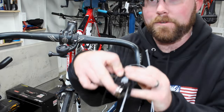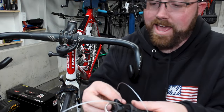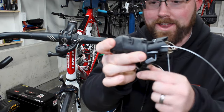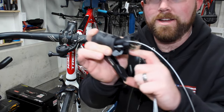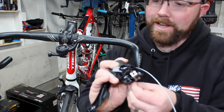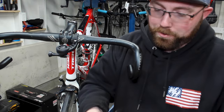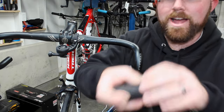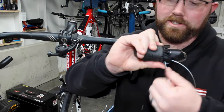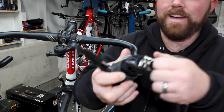On this side there's a gray cover that we can pop off just like that, and it just hangs off to the side. That lets us see in there to make sure the cable is going all the way through and gives a little bit of light on the other end. We're going to push our little lever all the way down and make sure we are in the highest gear to make sure the cable seat is fully accessible. Then we feed the cable through the hole and you'll see it pop out the other side. Pull it all the way through, and the little ball end needs to pop right into the slot and go all the way in. Then you can hold your cable and try to shift — it should pull your cable and move just fine.